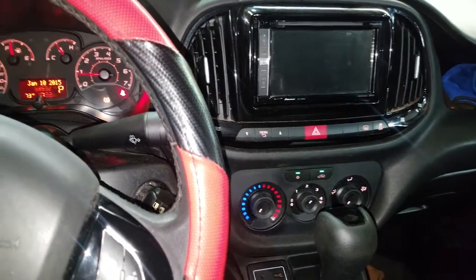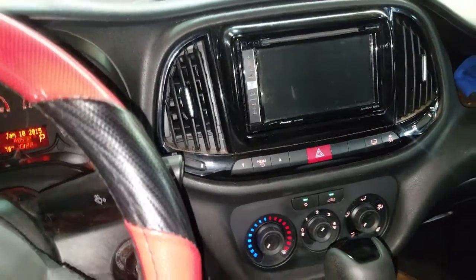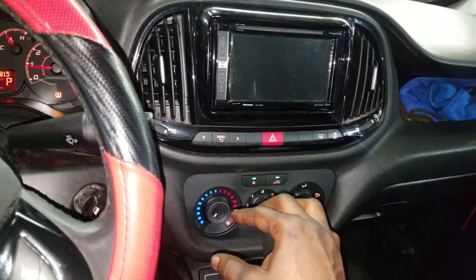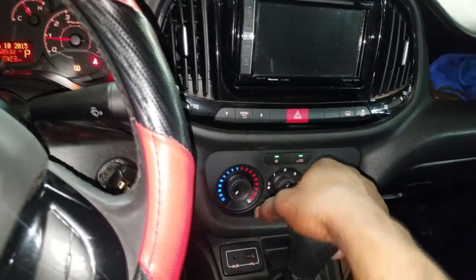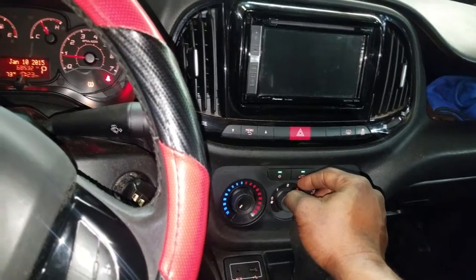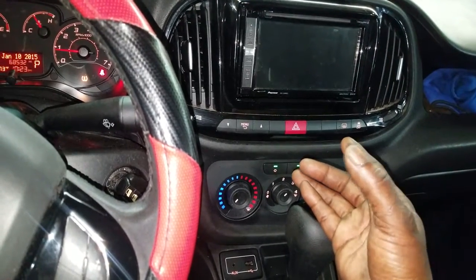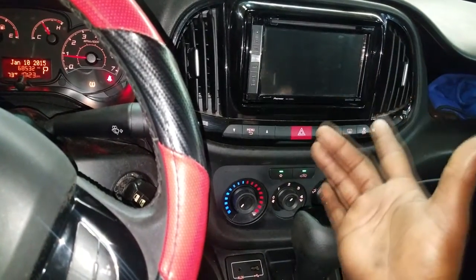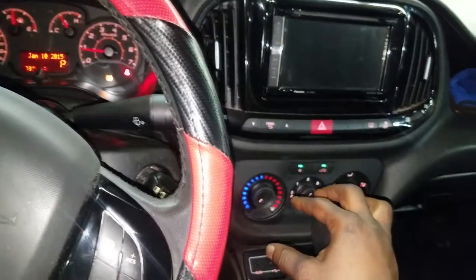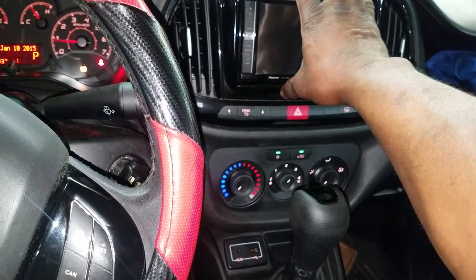For the consumer or customer who purchased the car and got this installed — and for the installers — I'm not sure if they scan the vehicle after installation to verify everything is right. She didn't start having AC problems right away because it's been cold and she hasn't been running the AC. But you don't know if your AC is working. Could be two months later you finally turn it on and it's not cold. You take it to a dealer and find out your bus is not working as designed because this entertainment module could be corrupting the bus network.